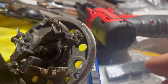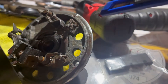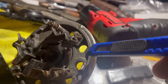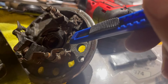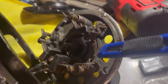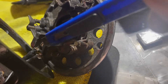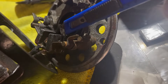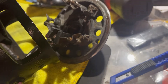You do not want this third brush moving around while you're driving, because if it does you'll get some real crazy results. Just make sure this is all clean and clear. This one's pretty clean — I put some oil on it, it moves, but it takes quite a bit of pressure to move. What we're going to do from this point is remove the wires that are attached to these two brushes. One of them is the output; the other one goes to the field coils that we're going to be replacing.